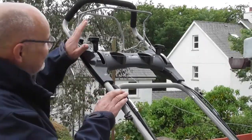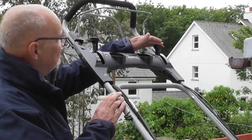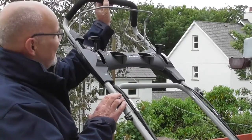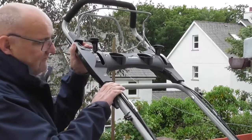This machine has four control cables: one for the speed changer, one for the choke, one for the OPC or operator present control, and one for the drive cable at the back that engages the drive. So we'll go through all four cables.